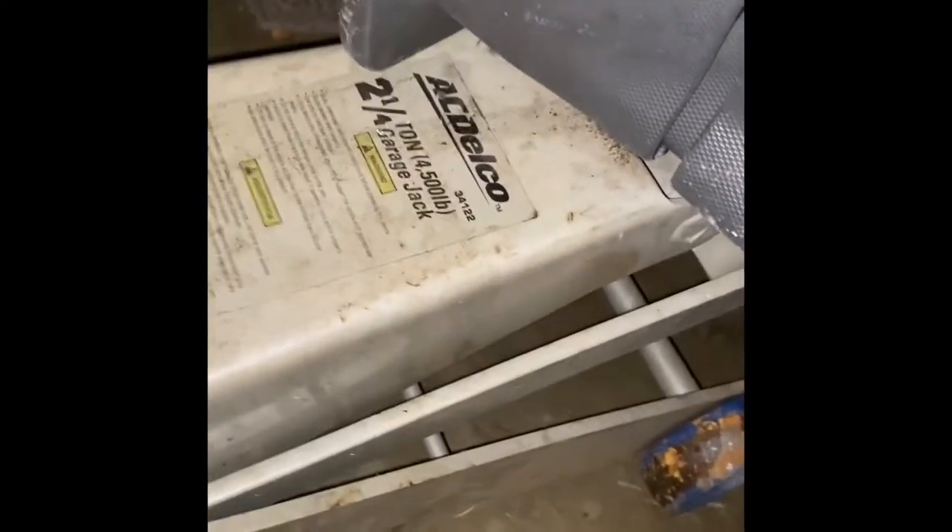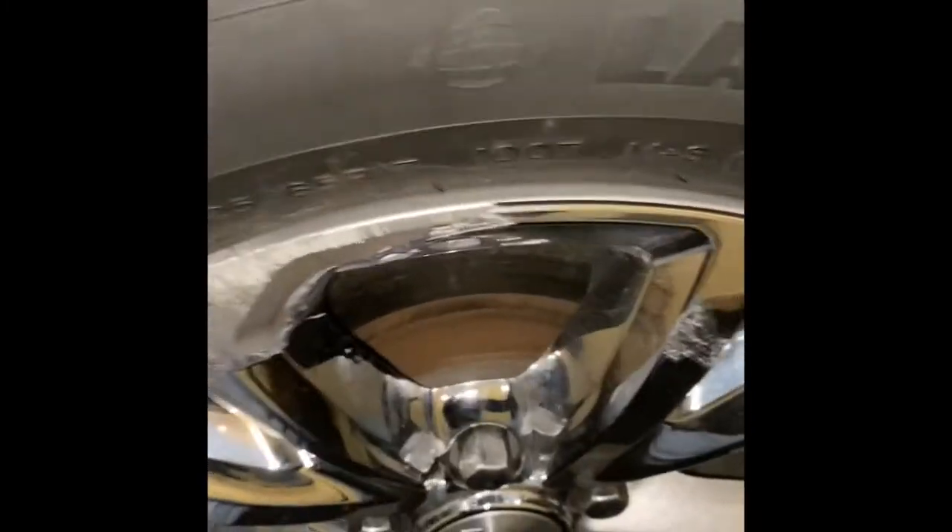I don't have a lot of room to work with, but once it gets on there and it doesn't push anything through — seems like the car's slowly coming off the ground. Let me double-check I'm not bending anything. It should be clear — and it is, just barely. Still on the pinch weld, looks good. I'll actually bring it back down to see if we're bending anything — nope, that's just fine. Before I take the wheels off and get jack stands underneath, I want to shake this wheel to check the wheel bearing.